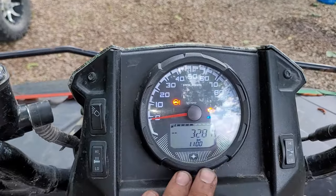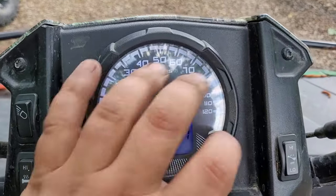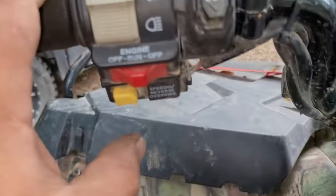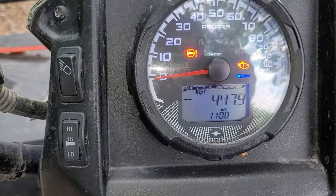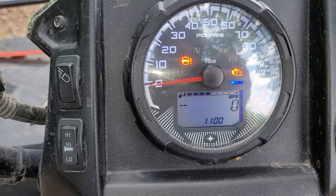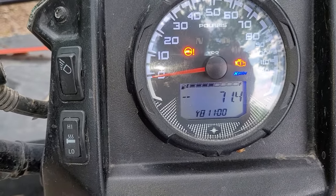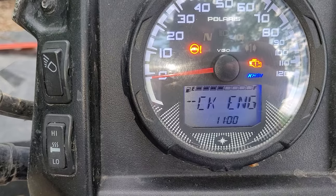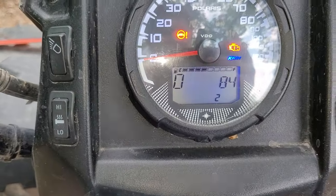Here's your regular speedometer readout. There is no mode button like the old ones — it's actually this little yellow button. Touch it again, and you'll see RPM and check engine light, then hold that button. Here's the codes.